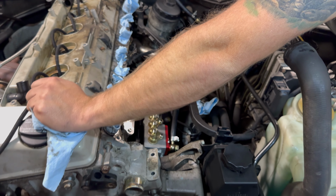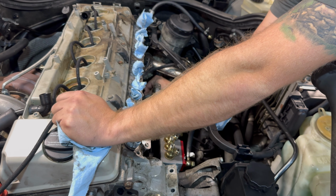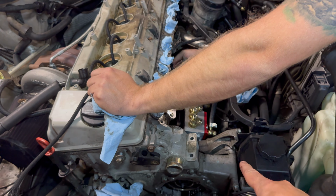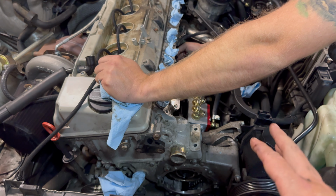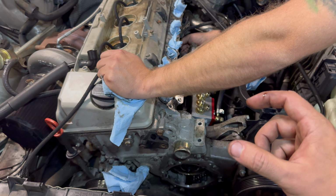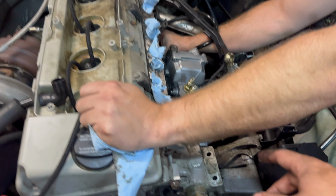And yeah, what's next after that? Basically start the assembly. Fuel filter, all that good stuff, do everything in reverse. We did have to remove this pump once or twice to redo top dead center, etc. But once you have that locking key in, it'll keep your top dead center. We had just messed with the micro adjustment.